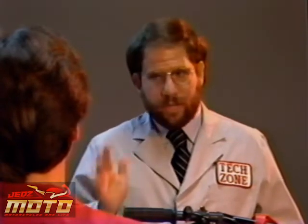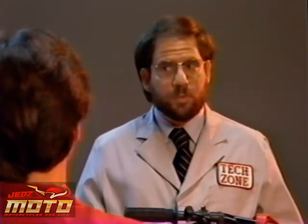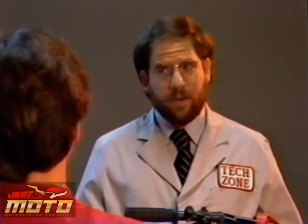Well, the jetting is right, the timing check's perfect, but the engine is still too hard to start. I could use a clue if you've got any. Remember that the HPP system improves this engine's performance for the entire power band by varying the size and opening duration of the exhaust port.